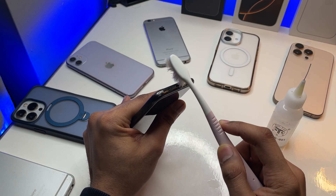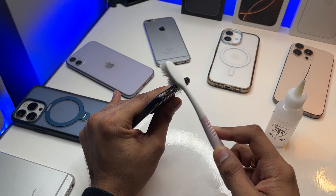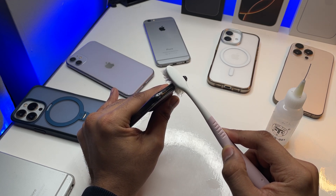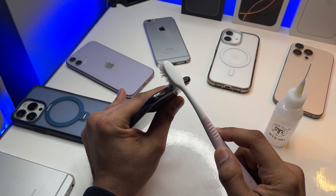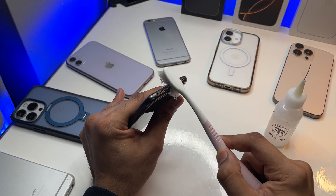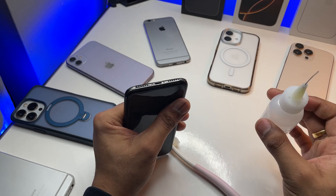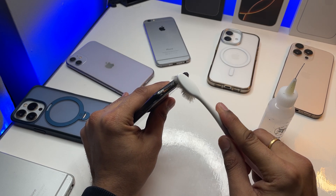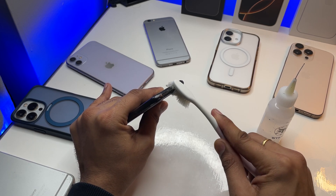Make sure you do not use too much alcohol. I'll try cleaning my phone's charge port gently. If the cable was not going in properly, there is something inside the port because lint has collected there. Clean the port gently — give it two to three minutes. Dab and move the brush around inside the port to make the lint movable. You can also pour alcohol directly in, but use a really small amount to avoid damaging the backlight.